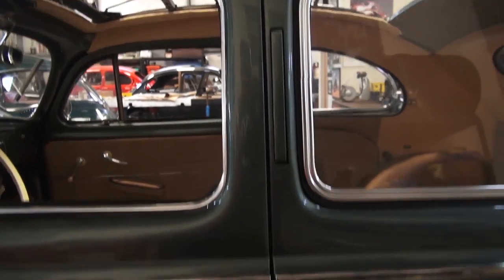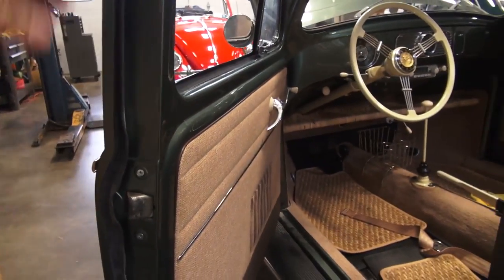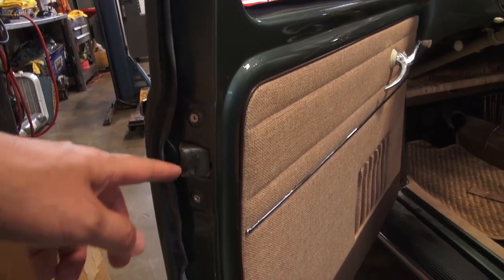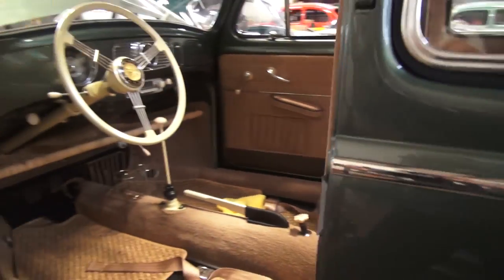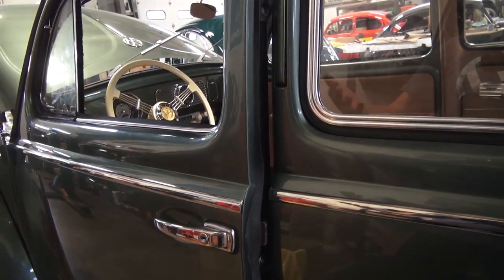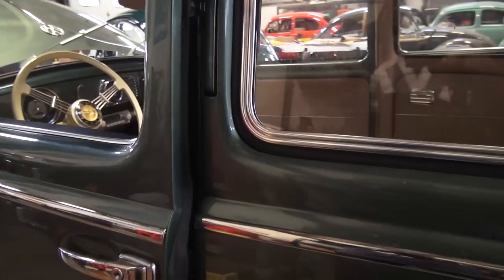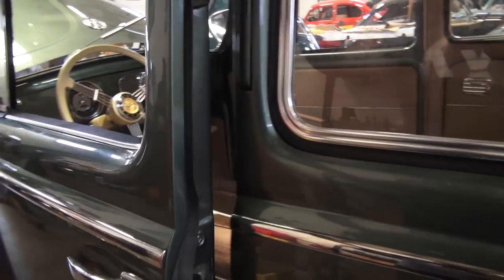The seam should be perfectly straight up and down, like you see here. The first thing you really want to do to line up your doors is — you don't want to have anything on the door when you're first assembling your car. No seals, no latch mechanism, no door handles, nothing — no striker plates in the jamb. Test the door shut with nothing on it, make sure it's lined up straight, then slowly start putting things back together, like adding the door seal next, then shutting and seeing how it lines up.